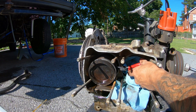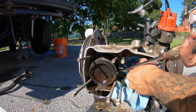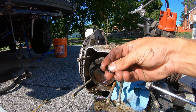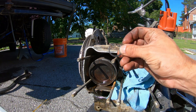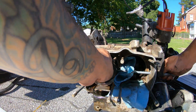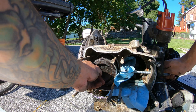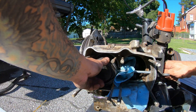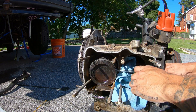Cleared it out. What I like to do is just squeeze it, walk it a little bit, and make sure the magnet's got a good hold of it, because if this goes flying it'll go inside the block and ruin your day — then you've basically got to fish it out or tear down this entire block. So coming in like so, just not right onto it — yep, and we're in. Make sure the tool is not on the actual circlip itself, because that would suck. Again, this is my first time doing this, so appreciate you bearing with me and learning while I learn.